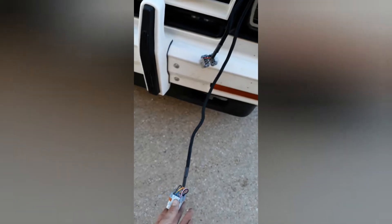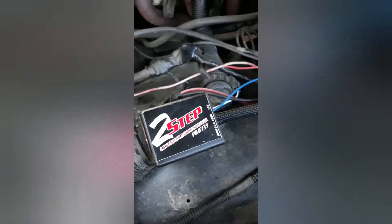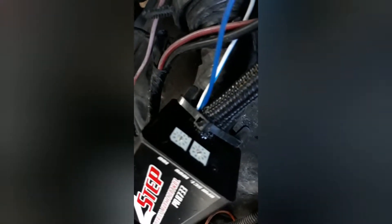One side is much longer than the other, so that depends on where you want to mount your control box. I'll probably mount mine on this side. This is the MSD two-step, part number 8733. It's direct plug-and-play. It's got a harness coming out right here where your adjustment dials are — one for 100 RPM, one for 1,000 RPM. The harness wire connects right into where your coil packs originally connected to your wiring harness on both sides.